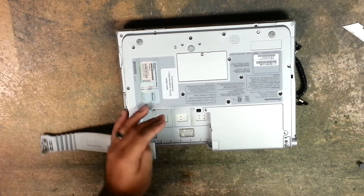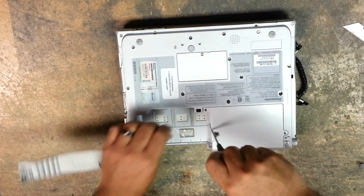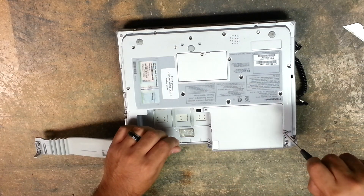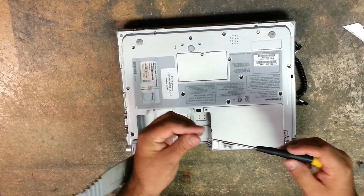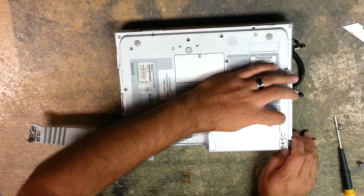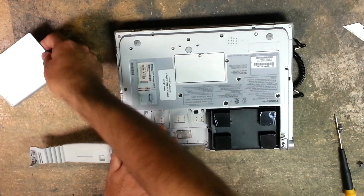I fold over the strap and hold it down. There are three screws holding the hard drive cover — actually it's a total of five, because those two that you removed from the inside also hold the cover. Then you slide it towards the battery, lift up, and pull away or pull towards you.